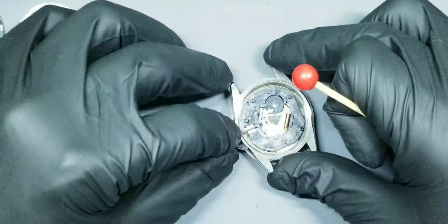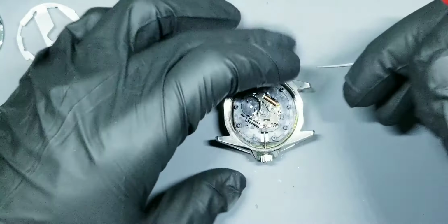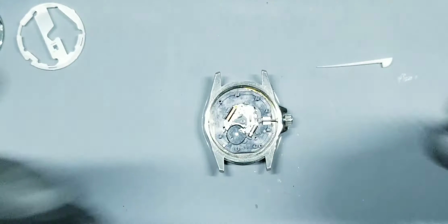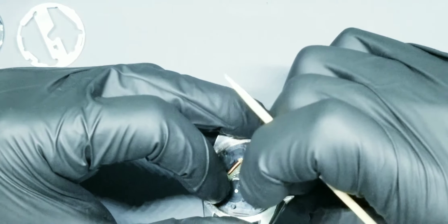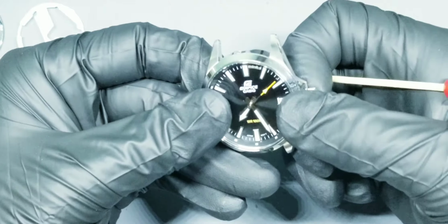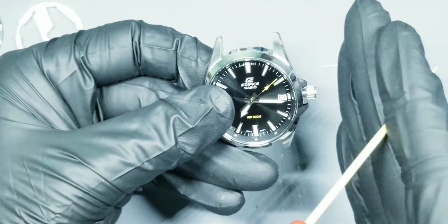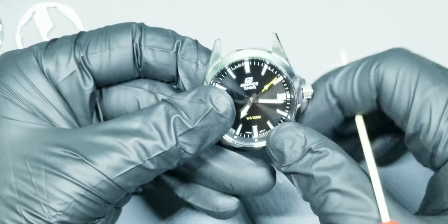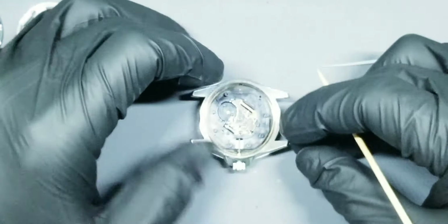So you want to go ahead and, for this particular watch, have the crown unscrewed. So we're going to unscrew the crown first. Okay, and that's considered now the home position. If you pull the crown out one click, you're now in the date position. That's where you can adjust the date. If you pull it out one more click, you're in the time position, which is where you can adjust the time. Okay, the time is the furthest out position. We want to be in the furthest in, okay, where turning this does nothing to the date or the time. Okay, once you've done that,